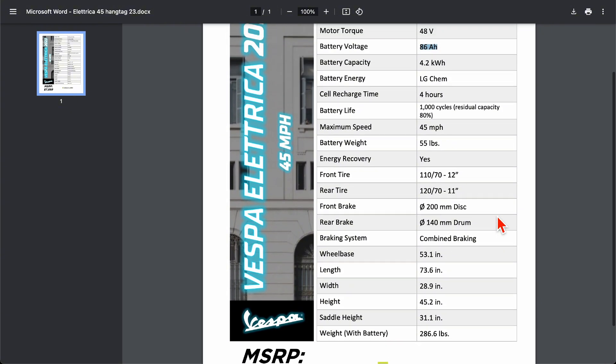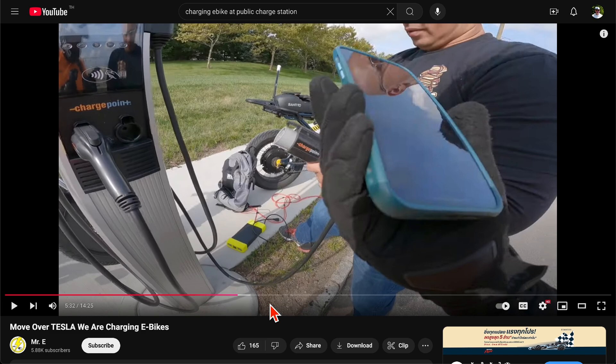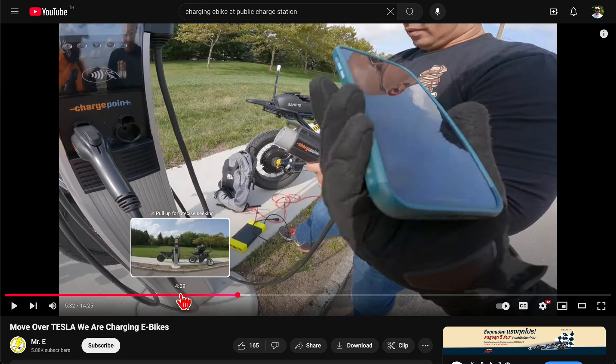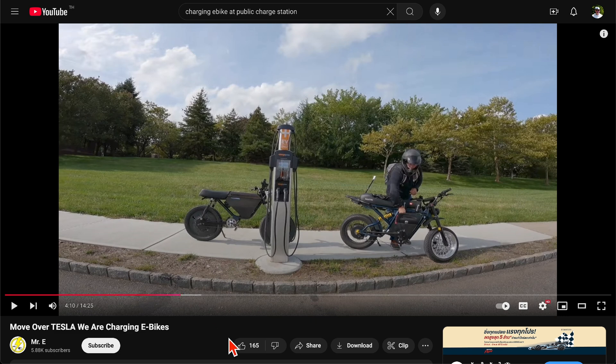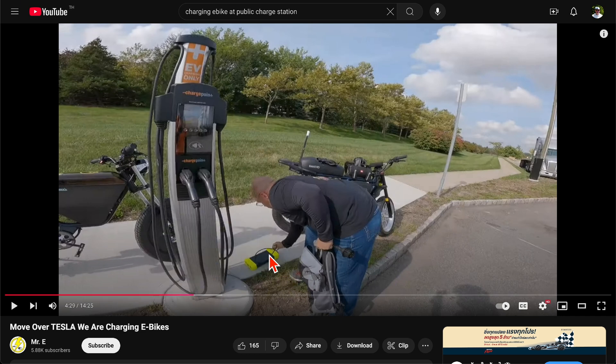What if you don't have a 240 plug at home? Having to charge overnight isn't a big deal — the big deal is charging on the road. There are videos of people riding high-powered e-bikes that are really glorified electric mopeds, using an adapter and an upgraded charger — not the stock charger that came with the bike. The concern is that many of these chargers charge at far higher pressure and speed than was part of the original engineering plan, which could cause a fire. My concern isn't the bike catching fire outdoors, but that fast charging could degrade the battery so that it later starts a fire at home during normal charging.